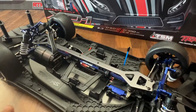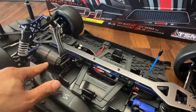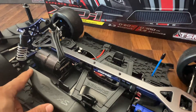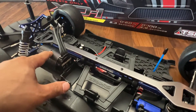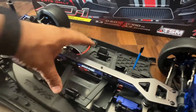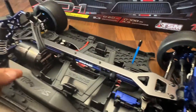If you look at one of the cool features here, you have a vent that goes under the car. Air comes in and actually cools the motor — really nice, a very nice design. It's not like a fan that takes power from the speed control; this is a completely mechanical, passive design and very welcome.